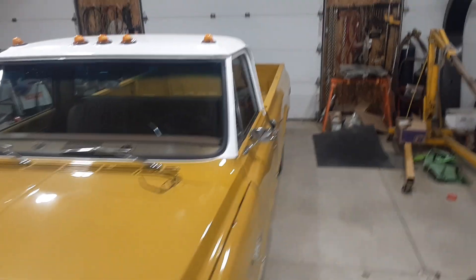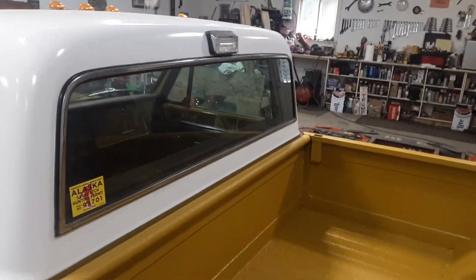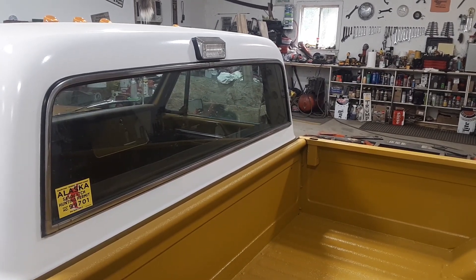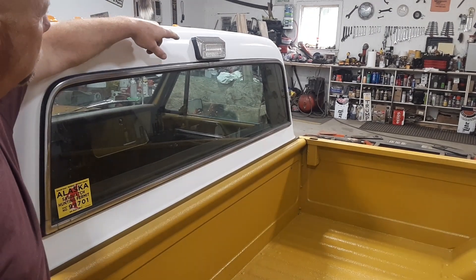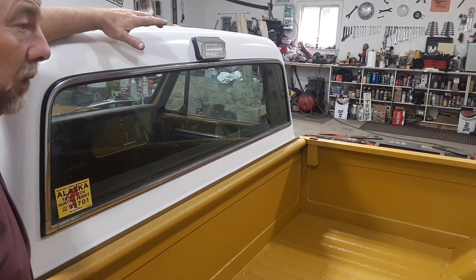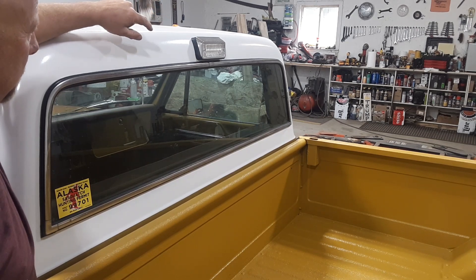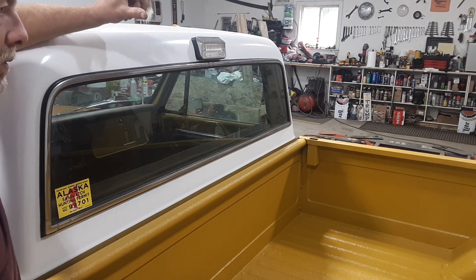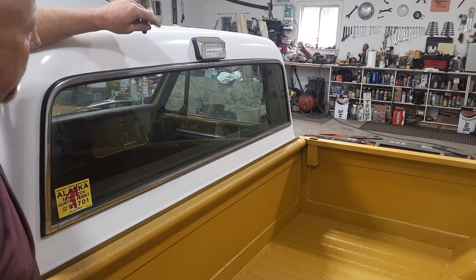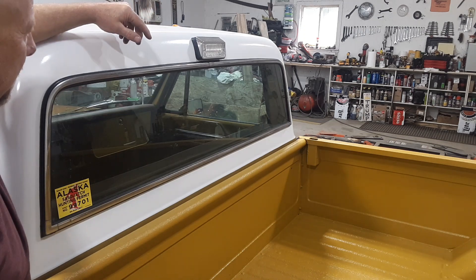I did find one other issue. I was so proud when I showed you guys - cargo light. A guy at the tire store said, oh, that's kind of cool you put that on there. He didn't realize that was an option on these trucks because so few of them have it. This came on this truck, so it's the proper option. But the same issue - the wiring harness where the light bulb goes in, the spring just lost its spring. So I'm going to have to buy a new end for that and crimp it in. It's watertight anyway and I'll do it watertight.